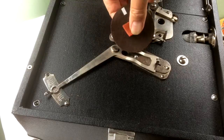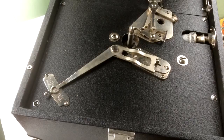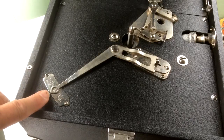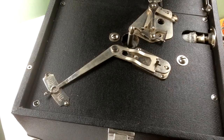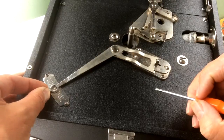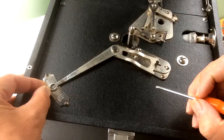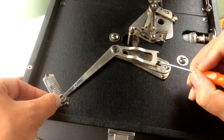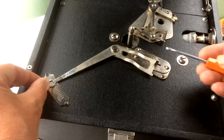But let's imagine that that speed was a lot higher. In other words, that while this was pointing at 78 here, this was revolving at around about 85. It was much higher than it needs to be. In that case, what we need to do is move the arm towards the slow. Now what's going to happen is, if you look at the movement in that little armature, as I move slow, it's moving forwards.